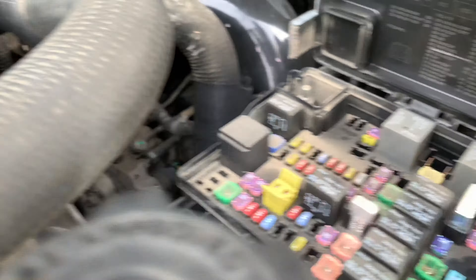Today I'm going to show you on a 2014 Dodge Cummins — and this will apply to other makes and models, I'll list them down below — where your trailer light fuse is. The other night I was driving home from an auction and all my trailer lights went out. What's crazy is I had brake lights, I had turn signals, but no trailer lights. I'm going to show you where the fuse location is for that.